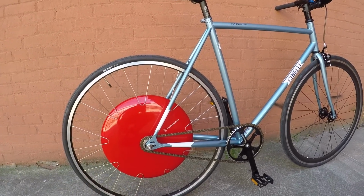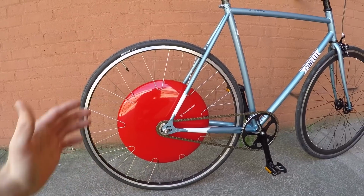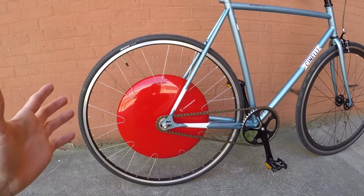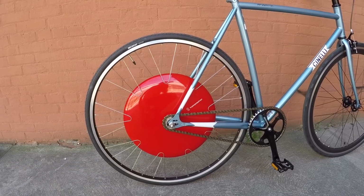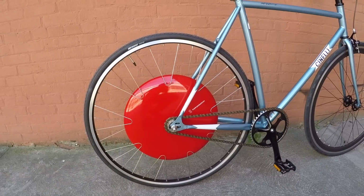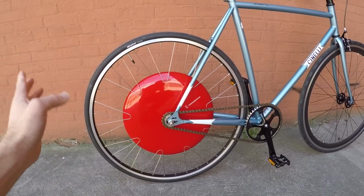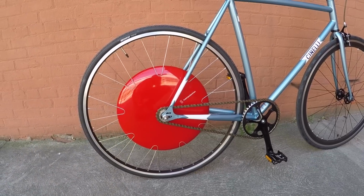And part of the reason I'm assuming this and communicating it is because you have a regen braking setup going on with this bike, and I've only ever seen that with gearless direct drive motors. They tend to be a little heavier, they tend to be very quiet, they tend to be durable because you don't have gears rubbing on each other. But in this case, you've also got battery packs lining around inside that casing. And the battery capacity is 48 volts, 5.8 amp hours, whereas some of the earlier models, I was told, were 5.5 amp hours. So we've got slightly higher battery capacity, which is nice.